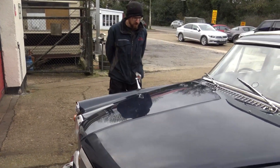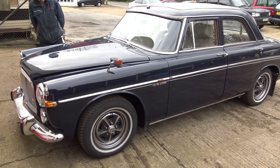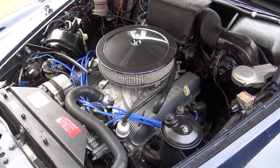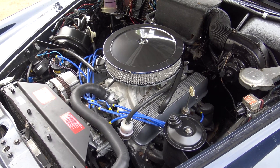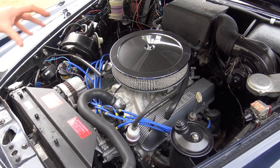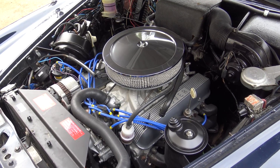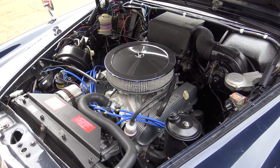This rather lovely P5 has been sent down to us. The customer has already applied our carburettor kit and ignition upgrades. The 3.5 engine has been rebuilt elsewhere, but unfortunately the customer isn't particularly happy with the rebuild — it's burning a lot of oil and generally just not running well. Despite our efforts to set it up and diagnose the problem, he has decided to have us build him an engine. The power plant we're building isn't going to be a stock 3.5; we've decided to increase capacity slightly — we're going for a 4 litre.